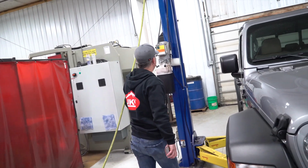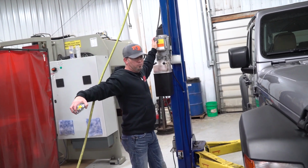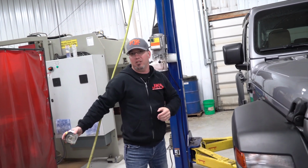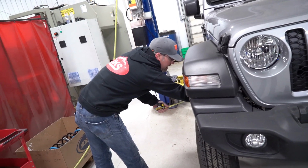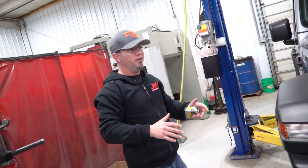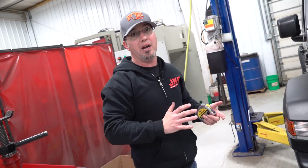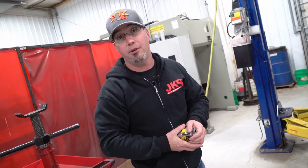All right, so I walk over here, and I raise this Jeep up. We'll say that's 6 inches, okay? So now we look at that same measurement, and we are already at 11.5 inches. So a 1/2 inch difference just with a few inches raised ride height. So extremely important. Let's get that vehicle at ride height to make sure the measurements we're taking are extremely accurate.